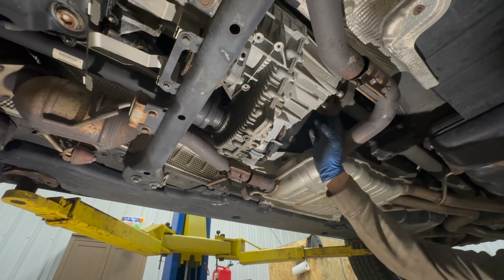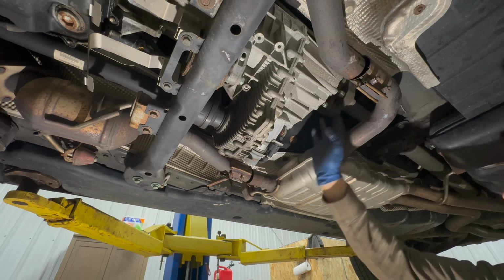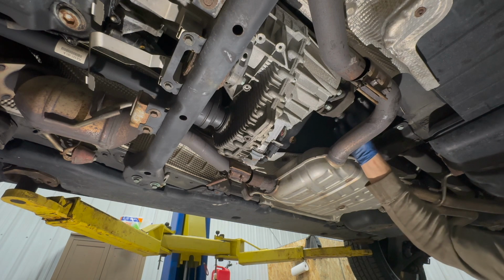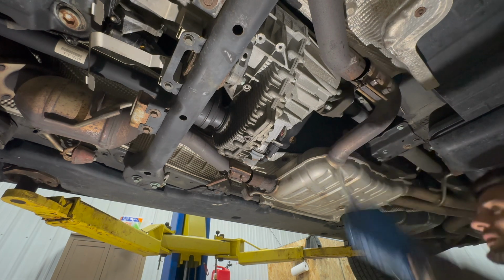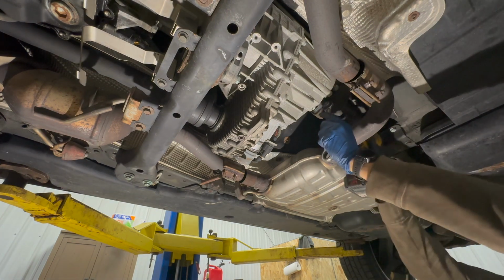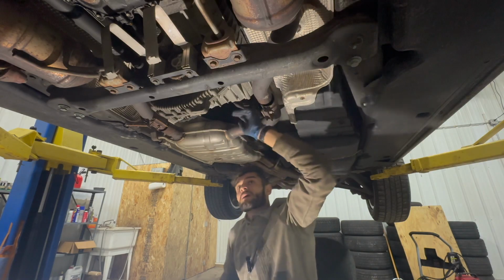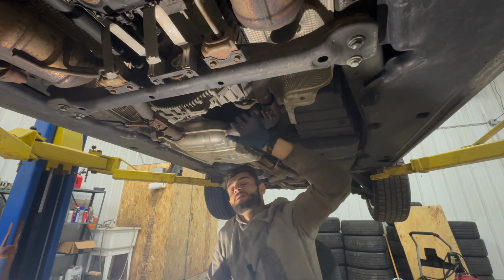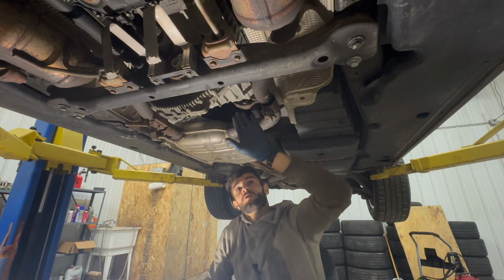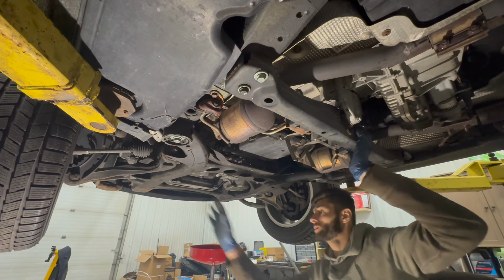And I think I'm just gonna unbolt it right here, which I'm assuming is the most common way of doing this, because the transfer case is gonna be coming out with the subframe. Looks like they're held in by 18mm bolts and 18mm nuts. But now that it's unbolted, I think once we do have the subframe unbolted, we can basically just give it a slight forward movement and this is going to come undone. I think that now we can move on to the suspension.